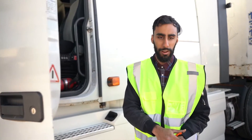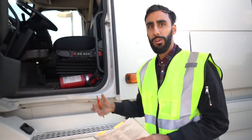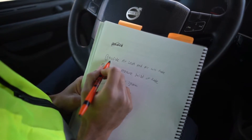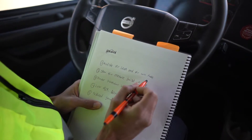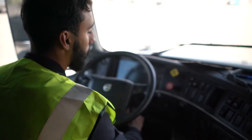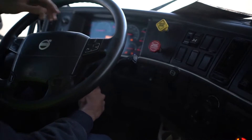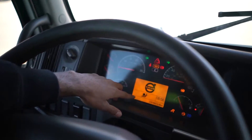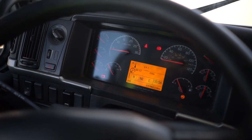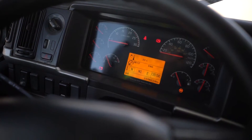Inside, we're going to cover the audible air leak and air loss rate. We're going to go in the truck and do the step-by-step process. The very first thing — when you start the truck, you've got to wait until the warning signs go away, because otherwise it will cause problems to the system. When you see them go away, you can start the truck.